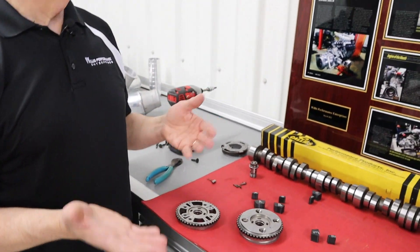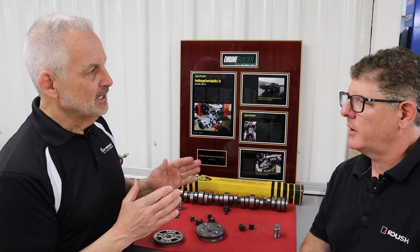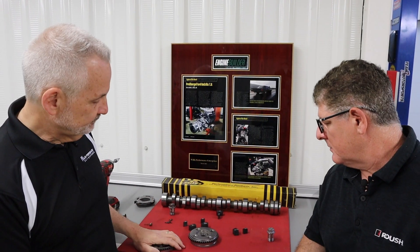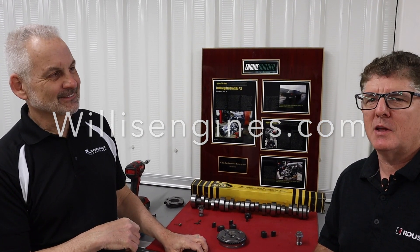You check cam timing — is it where you want? If not, you take the wedges out and put another set in. To be open about it, the tolerancing today is so good with aftermarket camshafts — it's normally within a degree one way or the other once you set that. So you shouldn't have to be going back and forth moving two degrees at a time, but you might need to. That's fantastic information, Brian. This is a kit that you sell — where can they pick it up? WillisEngines.com. WillisEngines.com — Brian Wolfe, Rev and Evan. Thanks for watching the channel, and come back for more.